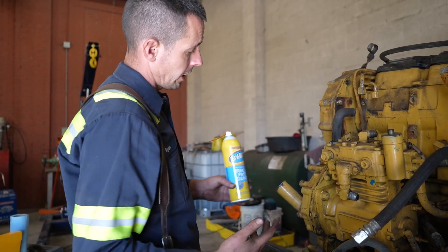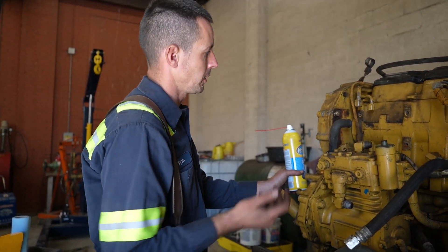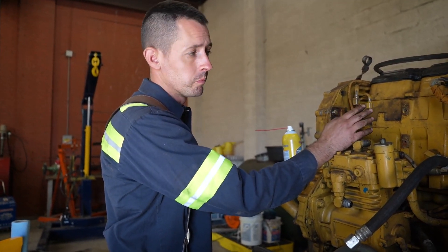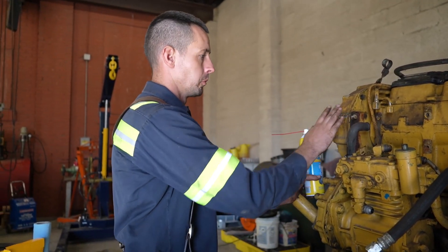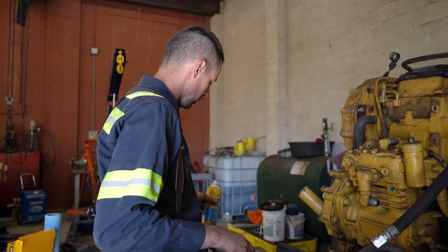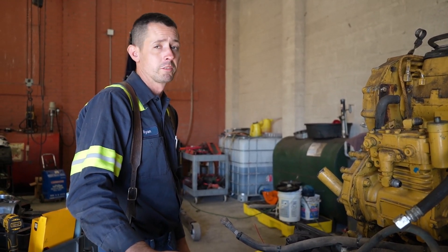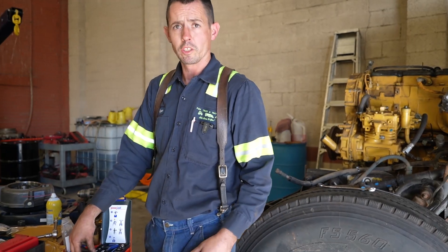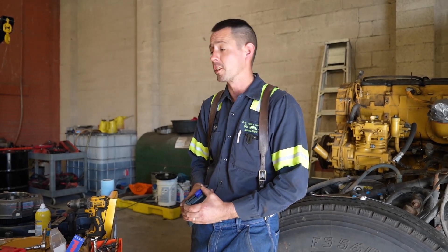That's pretty much it. Typically they advertise that helicoil threads are stronger than the original threads. I have never had good luck tapping straight threads into aluminum — they typically always pull out — so it's always good to use a helicoil if you have an aluminum housing you're trying to tap into. That's pretty much it for today. I'm going to go ahead and get everything cleaned up. This is something kind of new we're doing — just some casual, not so much how-to videos. Eventually we're going to do some live stuff once Sophia's helping out a little bit more down here, so stay tuned.